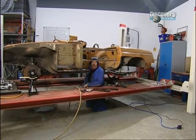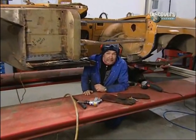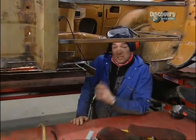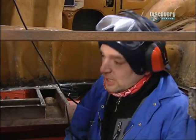Aha! Yes, the old broom trick worked very nicely indeed. It stopped me going completely mental with the old tools and cutting out too much bodywork. But you can see a fair amount has gone. The whole floor pan on this side has gone. Originally, we didn't think we'd have to change that, but it had a few holes in, so we had to take it out. Plus, all the sills have gone, obviously.